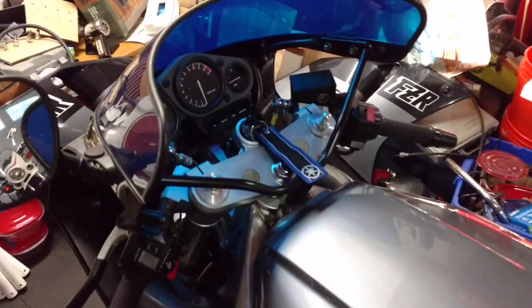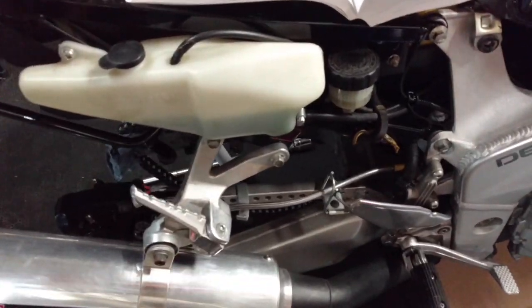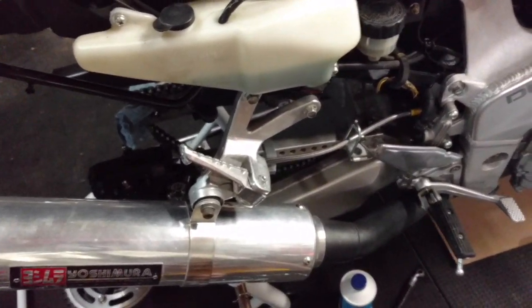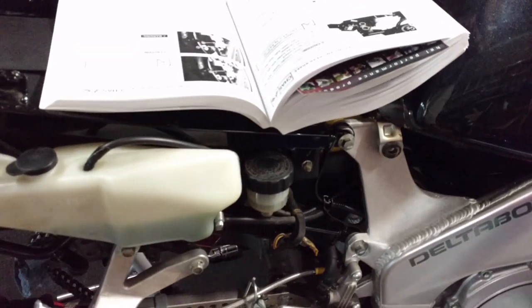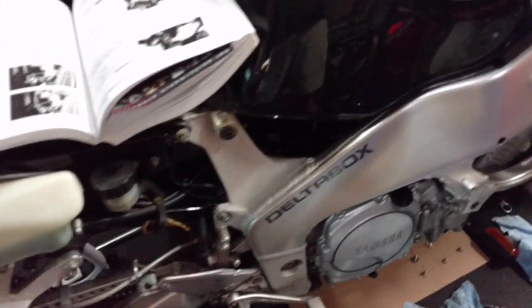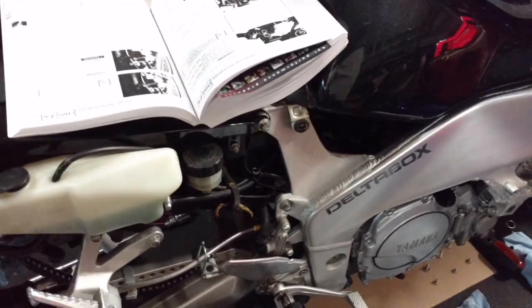I've got things tightened up now. I may spend some time trying to get the brakes bled. I do have a little bleeding setup with the Mighty Vac, and I was trying to bleed the rear brake. But now that I have the disc out of there, I can't really do that. I flushed all the old fluid and I've got clean fluid in the reservoir now. I'm just trying to get that flush through and get some pressure on the pedal — but that'll have to wait. The bike will be down for a little bit, but it should be better than ever when I'm done.